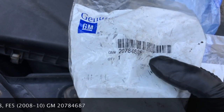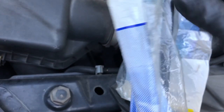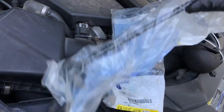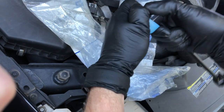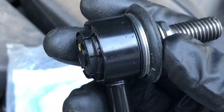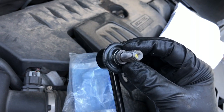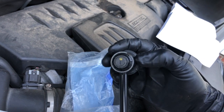The part number for the FE1 code is 207-84686. There's also an FE3 and an FE5 — I'll roll those other part numbers. These stabilizer links are all different from each other. This is what the most common one, the FE1, looks like. You can see the flats they put on here are very small, so they easily corrode off or get stripped. That's why you want to be careful. Sometimes if it's not too bad you can get it with a box-end wrench, but then you have to graduate up to vice grips, and sometimes up to popping the stud out and using the pipe wrench.